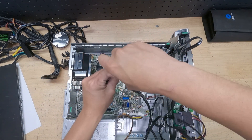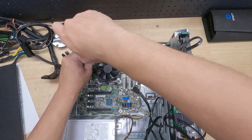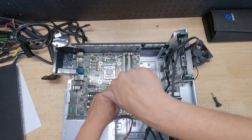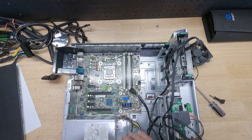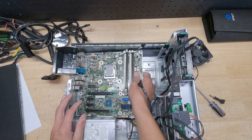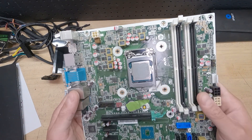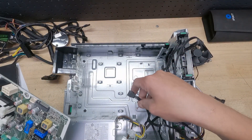Just to briefly show you: go ahead and take this out. Once you take that out, pop this thing up. You'll have several screws on the motherboard — just take out those screws. Once everything is unplugged, go ahead and slide the motherboard out nice and carefully. Try not to scratch it or anything. And there you go — motherboard is out. That's pretty much all you need besides the drives and your SATA cables.